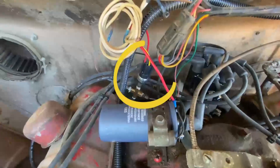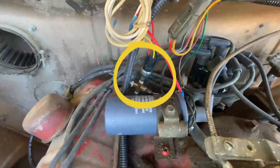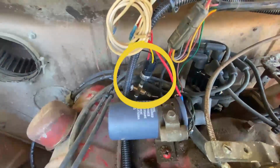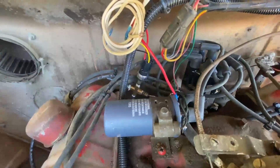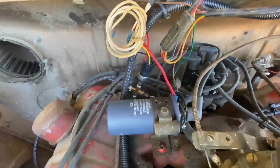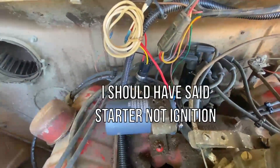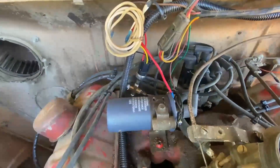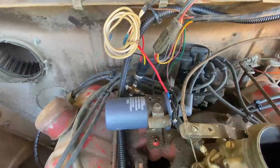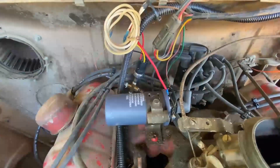At the back you'll see that little oil pressure switch that has three wires coming out of it, and that's going to be for my electric fuel pump. That way when you hit the key, you'll have ignition supplying the voltage to run the fuel pump, and then after the engine gets oil pressure it will take over and run the fuel pump.